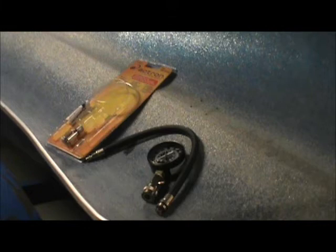With an outboard motor, a lot of times you don't have the opportunity to run it, or you have questions about its condition. One of the foremost leading signs of a good motor is the compression. To test the compression, you've got to do each cylinder, and under ideal conditions they would all test the same pressure. Five pounds would be real good if they're within five pounds of one another. Most manufacturers recommend between 10 and 15 between each cylinder. So if you're running 100 to 110 on every cylinder, you're probably in fair shape.